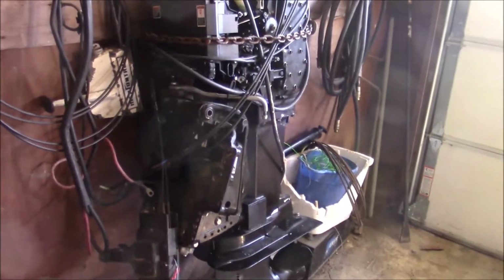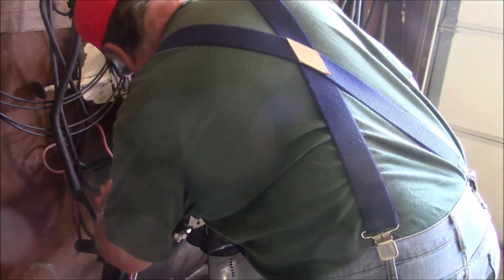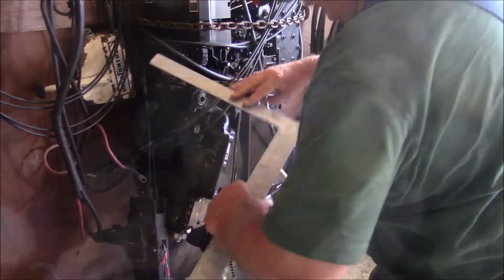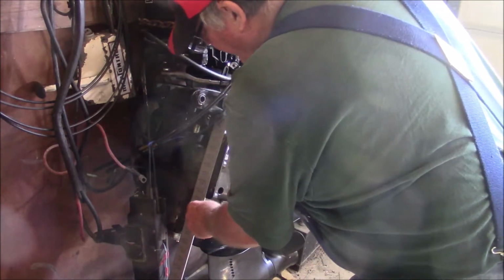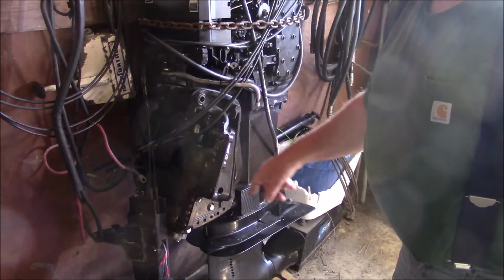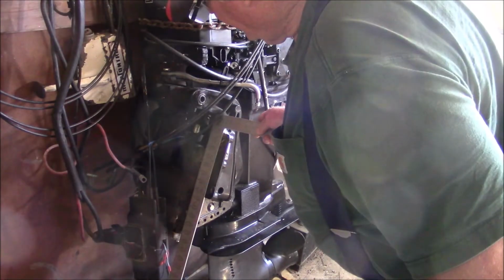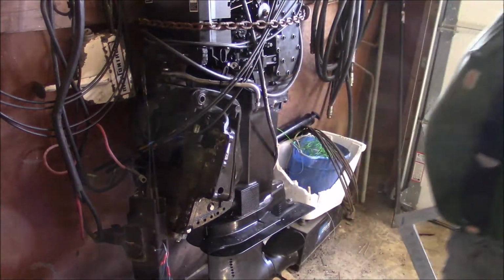So this is a Mercury, and it has a different template, and basically that's 13 inches across, and it actually can be down as far as 13 inches, 12, 11 inches is probably where this one's going to be. So this one could actually get down into that screw. So let's see whether or not, just based on what we see here, the orientation side to side puts us in danger with this outboard. Well, see, I could raise the outboard up, but usually it'd be still the 10, 11 inch range is where that screw hole is going to be.